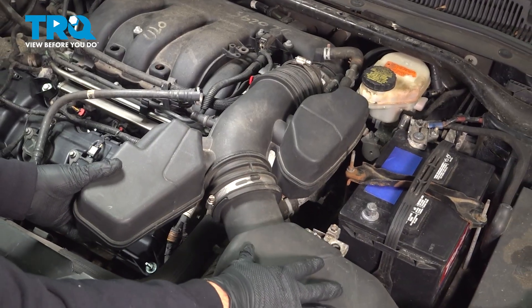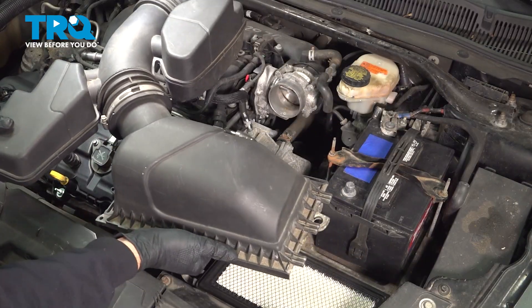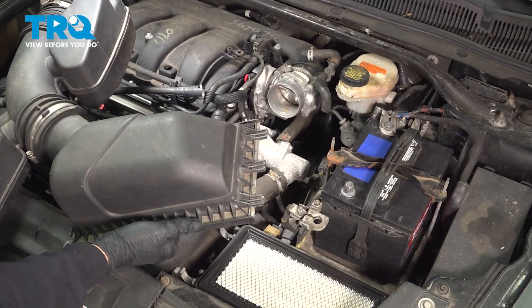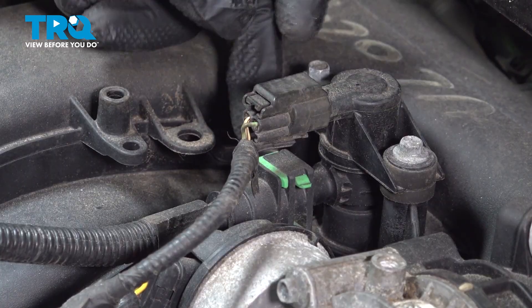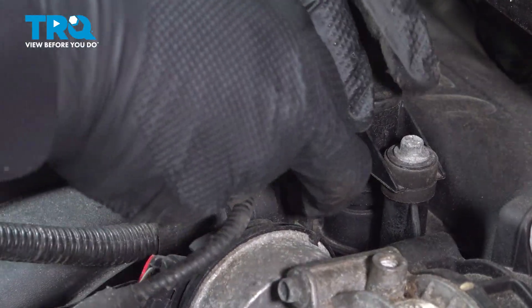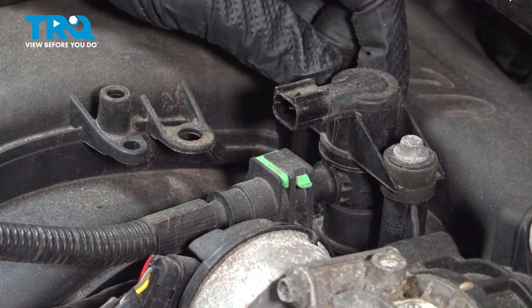Now when we lift this up, we're going to take the air filter lid box and pull it to the passenger side. The reason we're doing that is we have to disengage the three tabs here from the holes in the air filter base. On the top right here, we want to disconnect this harness — there's a little push tab. Pinch this little tab and pull this connector off, then tuck that off to the side.